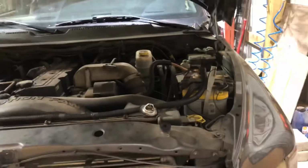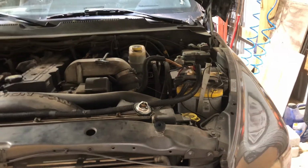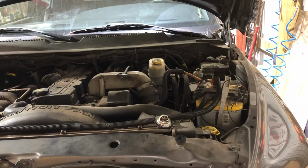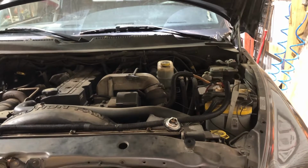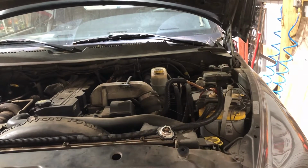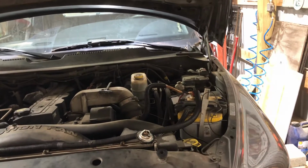So let's start off with safety. Chock your wheels. You might need to put the vehicle in neutral, move the gear shifter down, or else drop it down into low range, but don't depend on your parking brake. Chock your wheels front and back. Okay, and we're talking about safety.